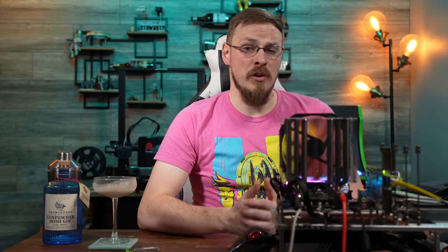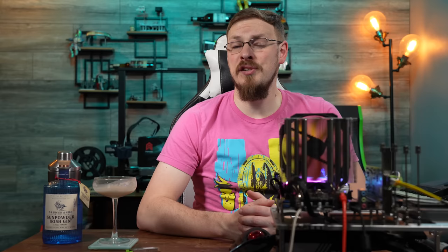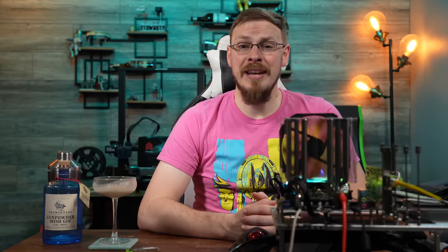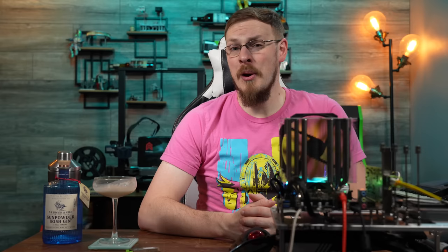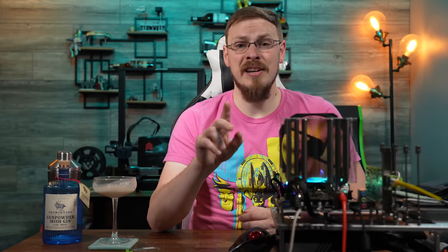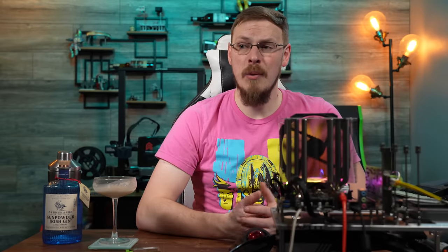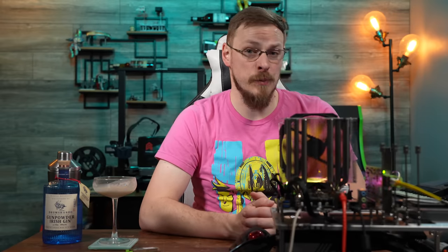Up next is my streaming PC running an Intel i7-7820X on an X299 Creation motherboard from MSI. Now, unfortunately, this particular CPU only has 28 PCI Express lanes natively, and so even though I do have an X299 Creation board, that second PCI Express slot is running at x8 speeds. So this is not going to be able to hit quite 100 gig, however, it should still be capable of around 64 gigabit of raw PCI Express performance.